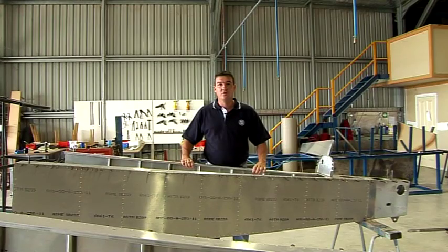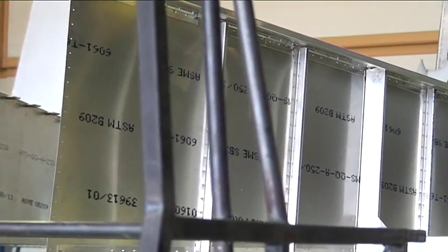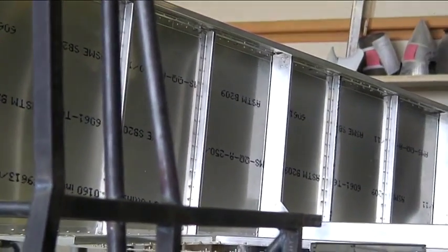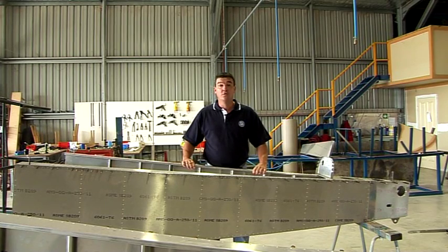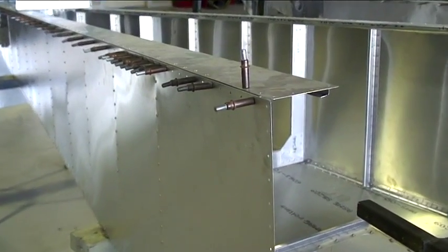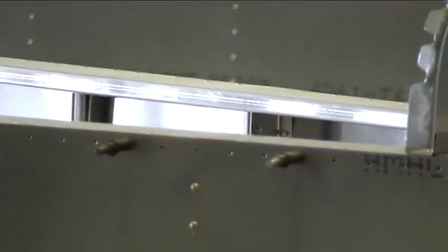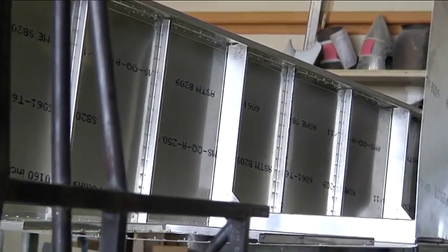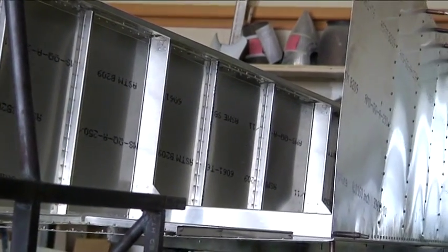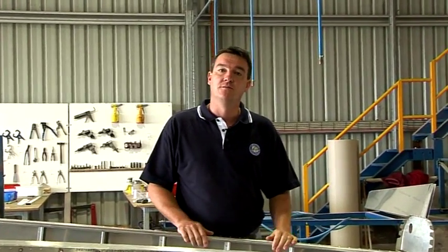As you can see, down to the rear of the Brumby is also all metal. We have a combination of very light aircraft grade metals, 6061 T6 and 2024 T3 alloys, forming a very light and strong structure. The aircraft also has a combination of pop rivets and solid rivets. We've chosen solid rivets internally as this stops movement and chafing. We have also the same construction technique on the rear of the fuselage.